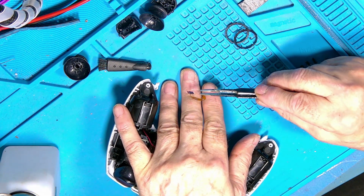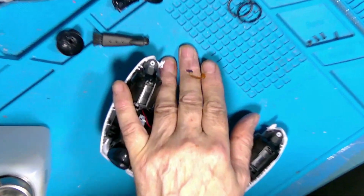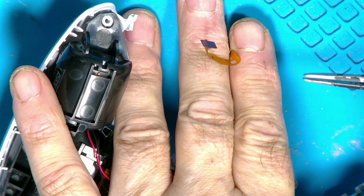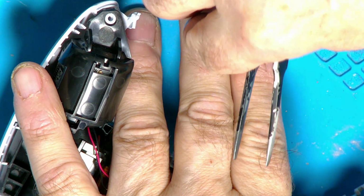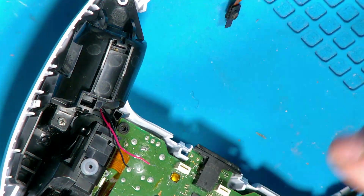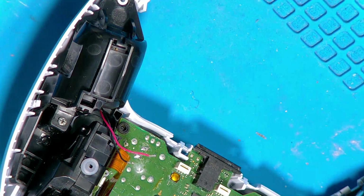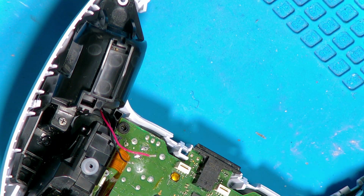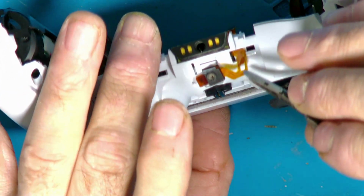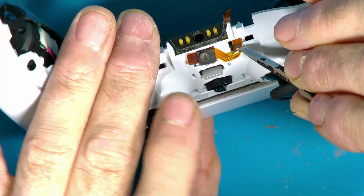On here, you can see it's like a T shape. Yeah, well that's because it's where it's fitted, it's pushed. It normally should be flat that way, like so. You need to make sure that it is flat before you try putting it in, because if you don't, you'll get caught up. But make sure you bend it the way that the ribbon needs to go. I'm going to have to unhook that again, because I'd rather push it through and pull it. By pulling it, it can tear.